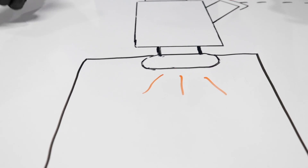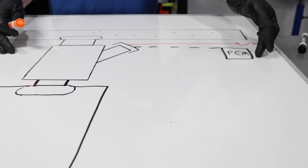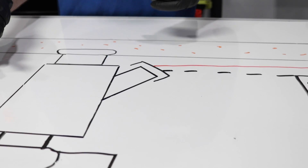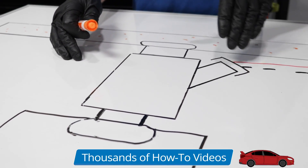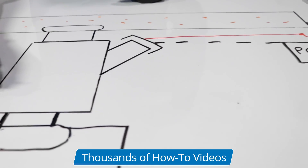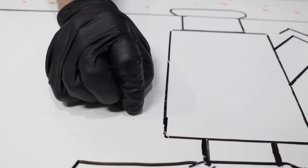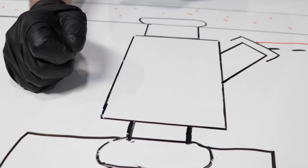Here's an injector that's working. What if we have an injector that's not working? How do we determine where that injector is? One way, you could use a scan tool and figure out which cylinder is misfiring, if it actually tells you that. Or if there's a code for the injector — if there's a break in the circuit — that could tell you which injector it is. But also, if you don't have either of those, when this valve opens and closes it's going to make a tapping noise, so we can go around to each injector and check for a tapping noise.